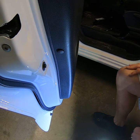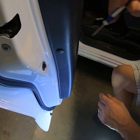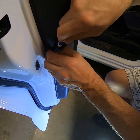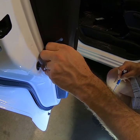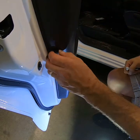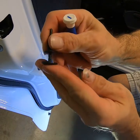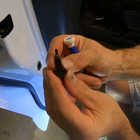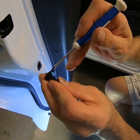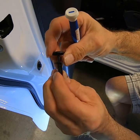If you watched me do the passenger side first, you'll notice I made a mistake — I forgot to pull this pin out on the side here. This is a push pin, so I've got to get in between the cap and the lid. There's a flat edge here; I stuck a little thin screwdriver, separated it, then pull straight back and the pin pops loose. What you're doing when you pop it is it spreads and keeps it from coming out. Once you get it, pull this out, which raises the pin and lets you push it in and out.